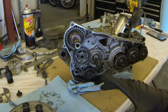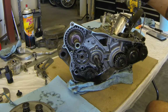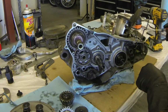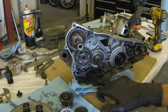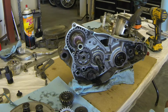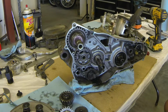You name it. So basically all these gears need to come out before you can actually split these cases. And then after all this stuff comes out, you're going to go ahead and pop all the bolts out of the other side. And so these 4 screws, 1, 2, 3, and 4, you're going to want to use an impact screwdriver, not the impact gun, not a regular number 2 Phillips head. Those usually have Loctite on them. They're really hard to get out. If you don't use an impact screwdriver and you strip them, you're going to be so upset. So don't do it.